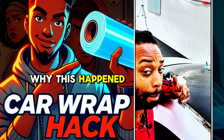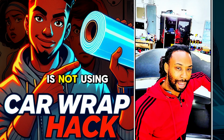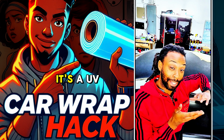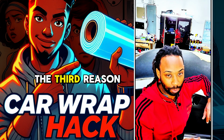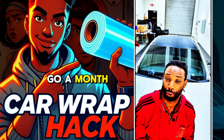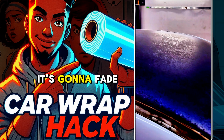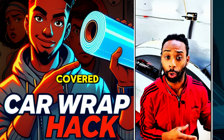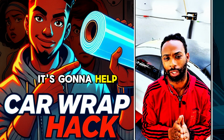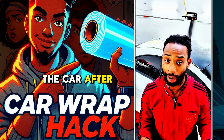Here's the reasons why this happened. One, they could have used cheap vinyl. The second one is not using the right aftercare products. A ceramic coat, you need that. It's a UV protectant for a reason. The third reason is not washing this car on a regular. Some people will go a month, 2 to 3 months and not even wash the car. If you don't keep this clean, it's gonna fade on you. The last one is just keeping it covered, whether it's in a garage, carport, or car cover. Do it because it's gonna help out tremendously. It's not the installer's fault if you didn't take care of the car after it got wrapped.